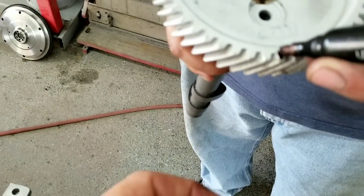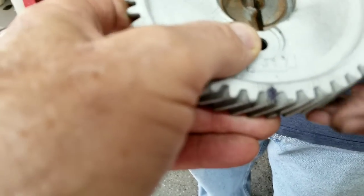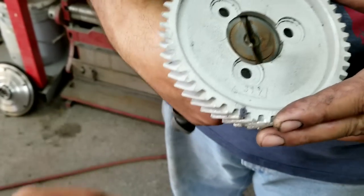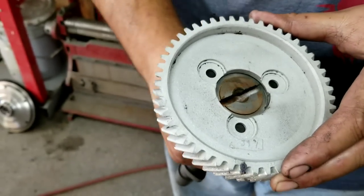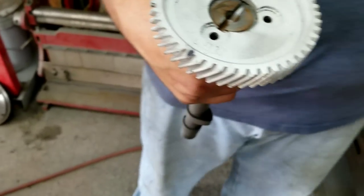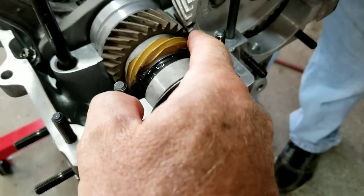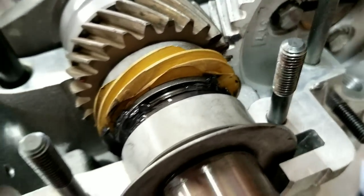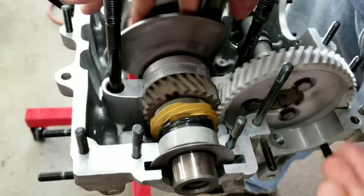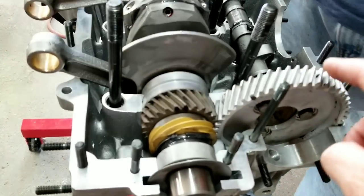You can see the little dot on the cam right there — that lines up with the dot on the gear. That's the correct way to put it on. If you try to put it on the opposite way, there's no hole there, so it's wrong. Turn it around where it's right — your dot faces the hole. Then you line up the marks: you've got two marks on the crank gear, and you put the one cam gear mark between them so they're lined up. Rotate it a couple of times to make sure everything turns correctly and there are no burrs in the gear.